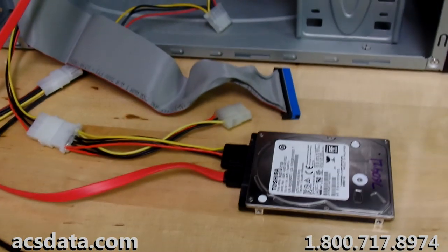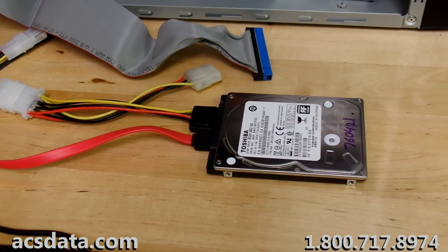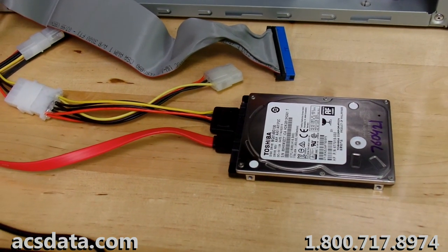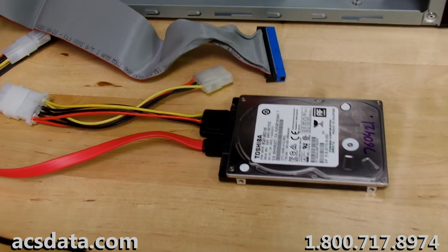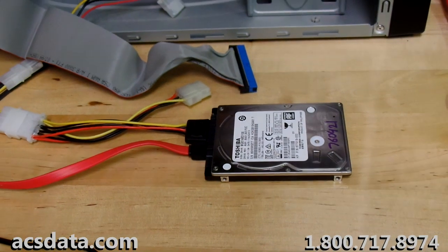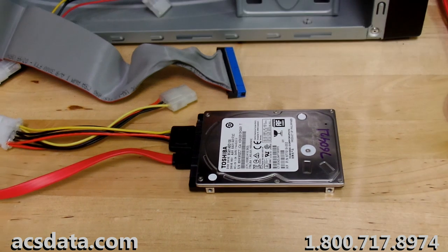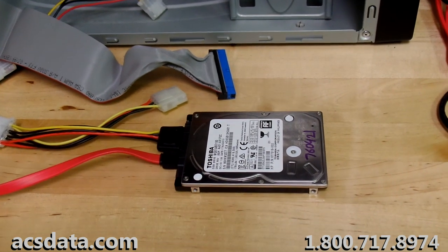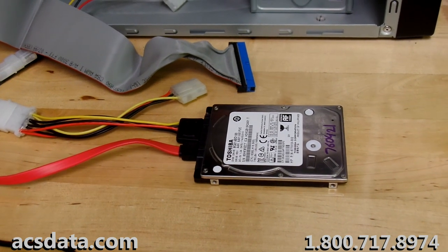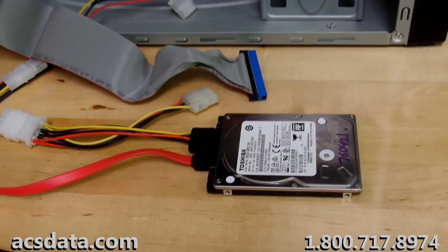Sometimes though, I've found that when I have drives that have heads that are iffy or platters that might be damaged, for whatever reason the Deepspar imager seems to be the better choice for those situations, at least in my opinion. It tends to put the drive under a little bit less of a load, it seems like, because I have had issues where I've used PC3000, started to image a drive that's very degraded, and it just does not function as smoothly as it does in Deepspar.